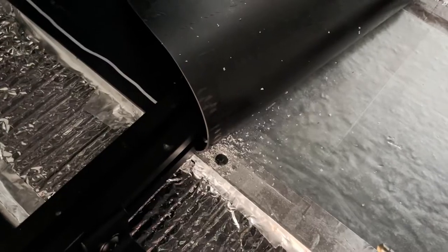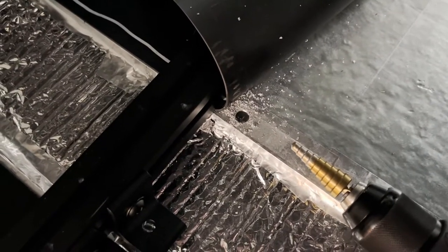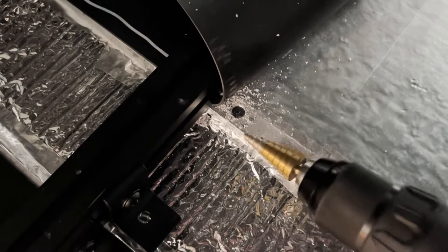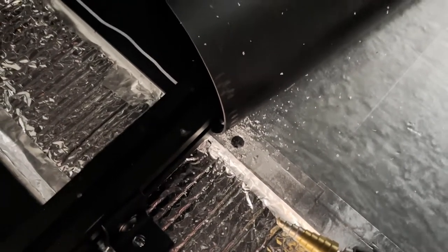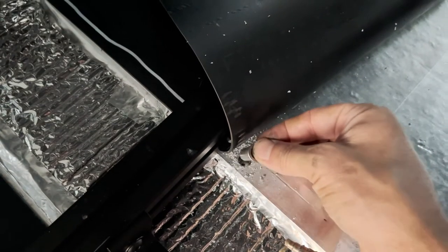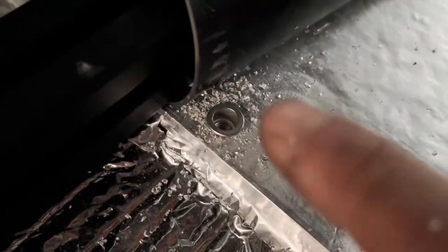You can see what a tedious process this is. First I'm drilling out a hole just large enough with this drill bit into the three-quarter-inch tube stock below to put my rivnut in. When I have it machined just right, the rivnut should set in just like that. Before I actually use the riv gun tool to clamp it in, I'm going to vacuum up all the metal shards and then put some epoxy on the bottom of the rivnut to seal it in there, then clamp it in.